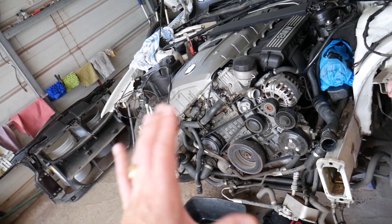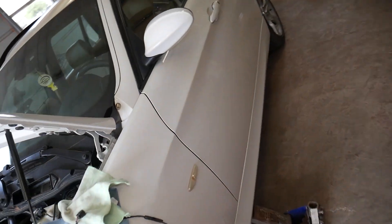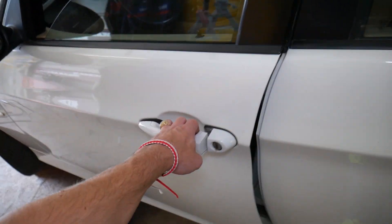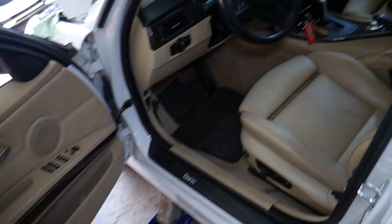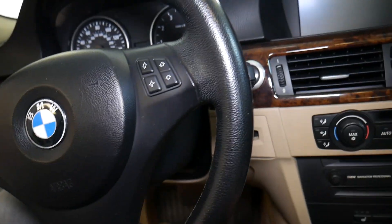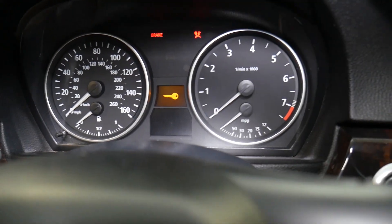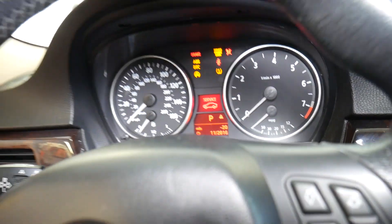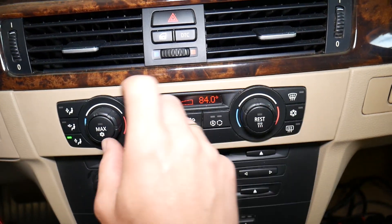With the coolant and radiator removed, you can hear the pump pretty loud so you know it's working. It's very important: when you start this procedure on your 5 Series, leave the door open — do not close the door, otherwise the procedure may stop. You're going to turn the ignition on but do not start the car. You will see the lights on, but do not start it.